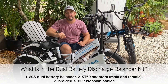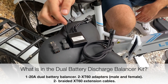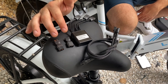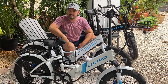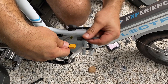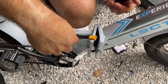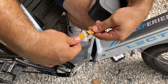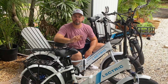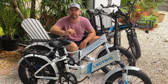A lot of people have been asking just what is in the kit, and those are generally comments from those who haven't purchased. So let me show you. Inside the kit you'll have two XT60 extension cables, one discharge balancer with black cabling and black XT60 connectors, and then you'll have the two XT60 to Dean's T-plug adapters. Another question we get is what does an XT60 adapter look like? Generally speaking, this is what you're going to find — this is an XT60 connector. If we were to hook this up with our discharge balancer, which is another XT60, you will see that they plug in like this. This is the common color for most XT60s out there, and you will see the opposing version here on the battery. We chose the XT60 connectors because it is a quality connector and it fits the bill at this amp rate or current discharge rate — this is a perfect setup for the Electric XP 2.0.